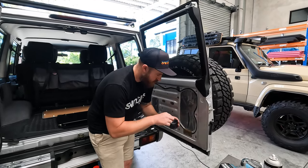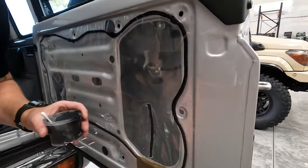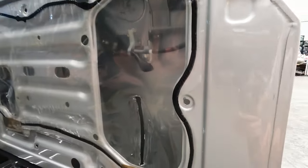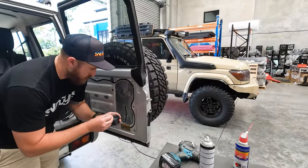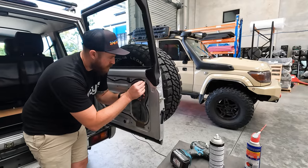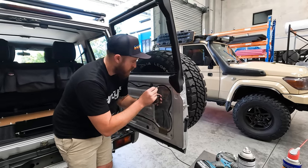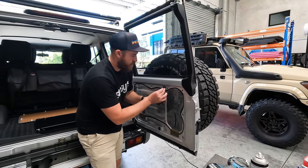And that's that, done. If you want to zoom in on that, you can see we've just coated that quite nicely. This is a fast-drying enamel paint, so it will cure very quickly. Just repeat the process on all 10 holes, let it dry for a few minutes, and then you can put your nutserts in.